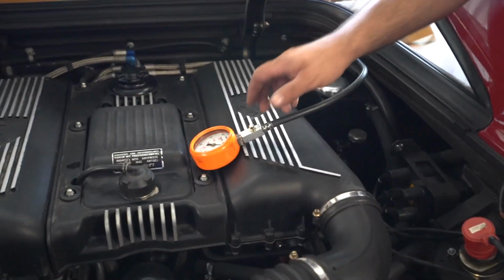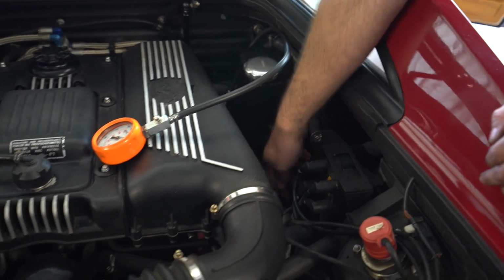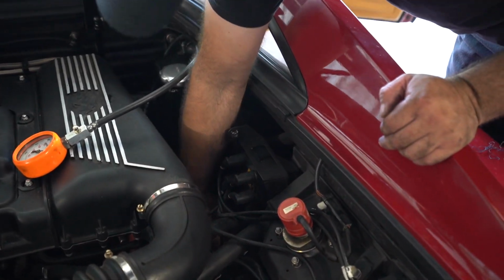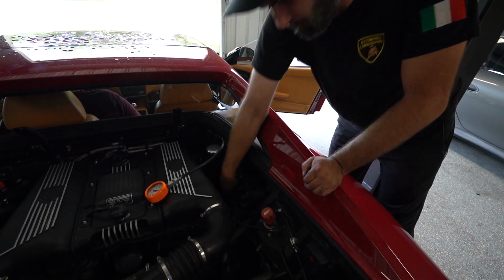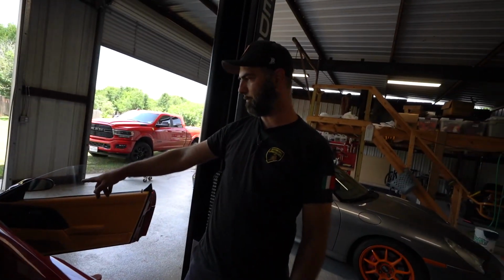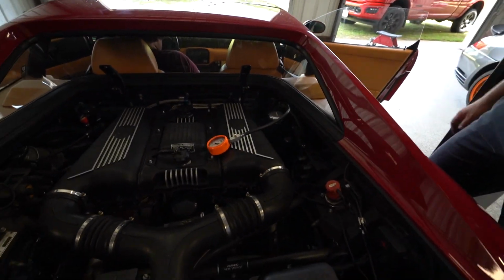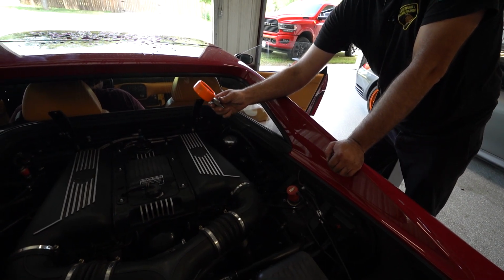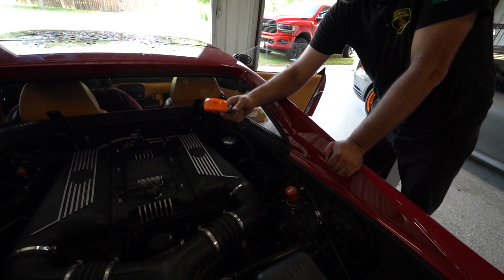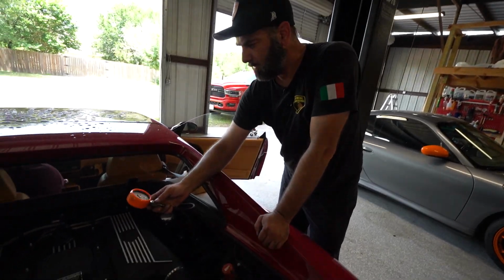Sorry. All right, which cylinder are we on? Cylinder one. We disconnected the main connectors to each of the ignition coils down here, so there's no more supply from the fuse box. And we went into the fuse box and pulled the fuse for the fuel pump as well. So there's no live fuel or ignition. Usually it's good to put a power supply on the battery to make sure the battery doesn't go low, but we should be all right. Okay, all right, go ahead.